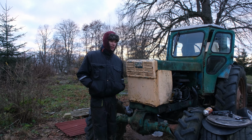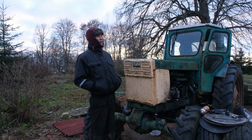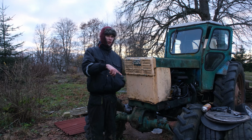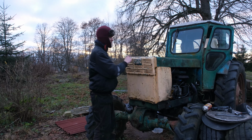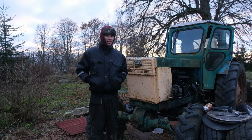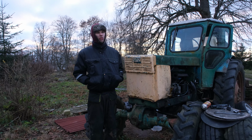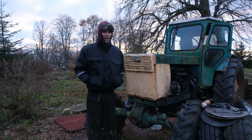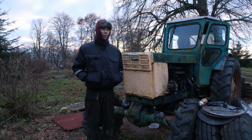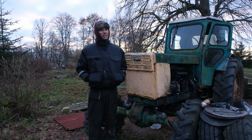Of the fuel tank, a fuel pump, I'm pretty sure there's only one way to insert it, but I'm not sure if you're supposed to put the engine in a certain way and then insert it. The fuel for the first cylinder matches with the first cylinder valves being flat when you adjust them. So in theory, it seems like it's adjusted, but the governor, which was causing the problem, which we told them to fix, which is why we brought it in, doesn't look like it's changed at all, and it's still stuck. It's supposed to move back and forth and govern the engine to run smoothly, and it's just sitting still.